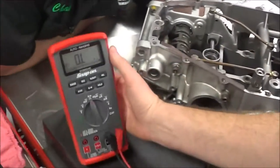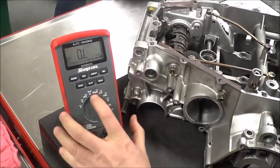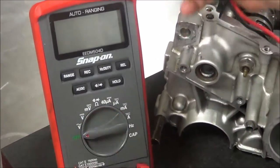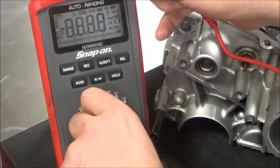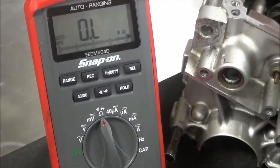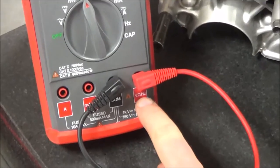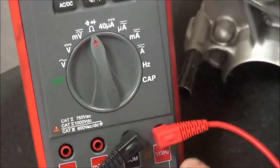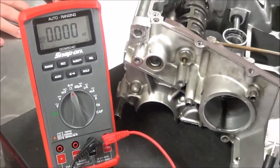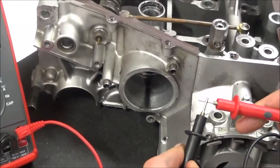I'm not going to do intense multimeter training right now, just something fun. You can see the ohm scale — that ohm symbol. I like to cycle a meter with no leads touching, go to the position I want. This is an auto-ranging meter. Black always goes in the common, and on the red you'll see the ohm symbol, so we're doing the right kind of testing. You'll get certified on this in January. Always touch your leads together and zero it out.